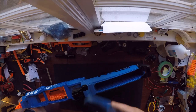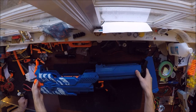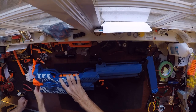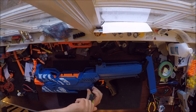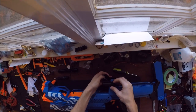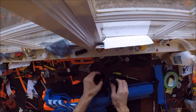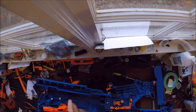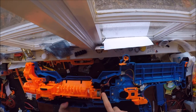Leave the door off because it's going to prevent us from successfully butterflying this open. Opening up the Nemesis is actually quite simple — they're all Phillips head screws, roughly size 0 or 1, and they all come out with great ease. The incredibly long ones are all surrounding the agitator. Two pieces come off and the Nemesis butterflies open. You can see the internals are exactly what we expect, very similar to the Chaos.